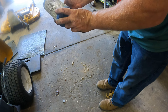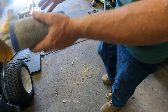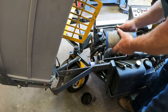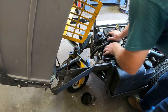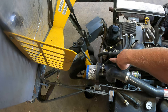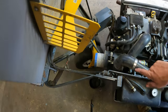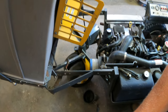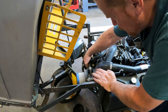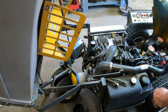I'm not going to recommend replacing the air filter just yet — a lot of people replace them just because, but this one is in good shape and has plenty of usable life left. The inner filter is nice and white and clean, so no debris is getting inside. The fuel filter right here is just a little plastic inline filter — easy to change. Make sure there's an arrow indicating direction of flow, with the bottom coming from the tank and the arrow pointing up toward the engine. This one looks correctly installed and fairly clean inside — no debris visible, so it's fairly recent.